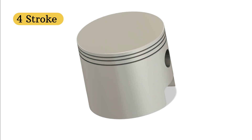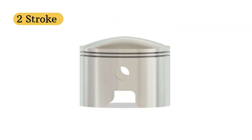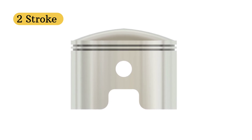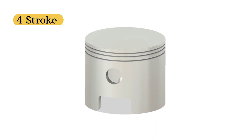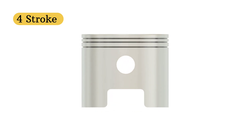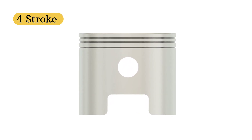It's all about stability. Piston rings are key. A two-stroke piston usually runs just one or two rings — enough to seal combustion but reduce friction. A four-stroke piston uses three rings: two for compression, one for oil control. More rings means better sealing, but also more drag.